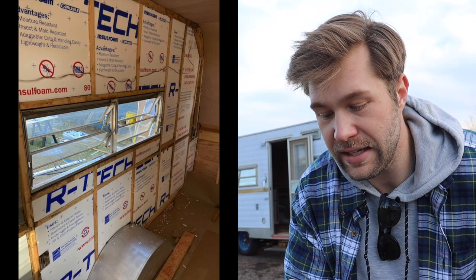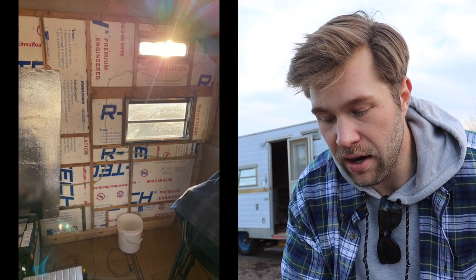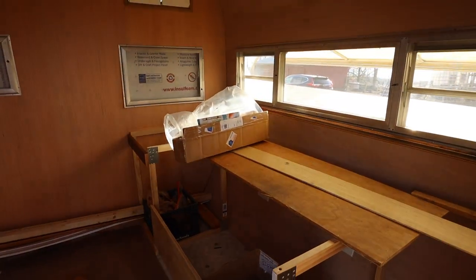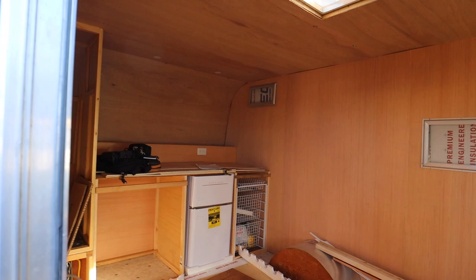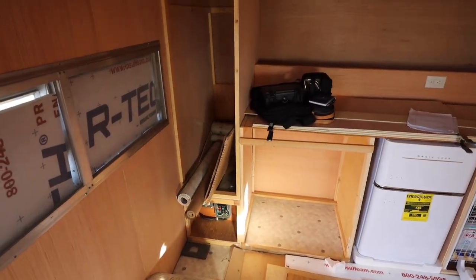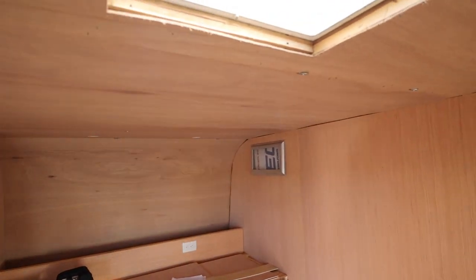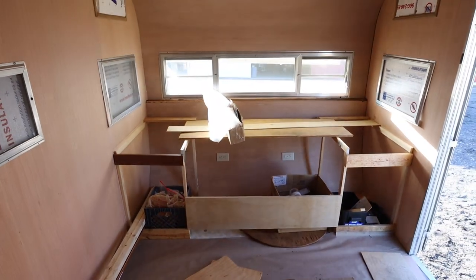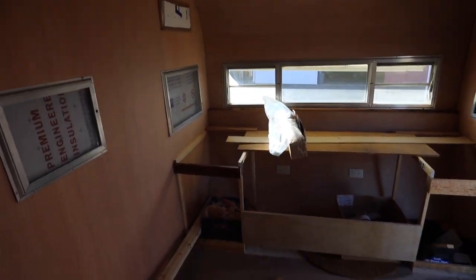The electrical was split into two parts: 30-amp AC down the passenger side, set up for a desk and a kitchenette. There are four LED DC lights above the kitchen and desk area — still need a dimmer switch and a battery. The electrical lines for the exterior trailer lights run down the driver's side and 90% is new wiring. There's a new junction box at the tongue to connect to the tow vehicle, and it's all wired for electric brakes — just needs the junction box, a quick five-minute job. A closet is in place and the front kitchen area has plans for a sink, countertop, microwave, and mini fridge. The trailer should be good for another 50 years.